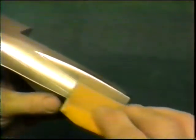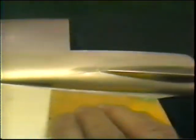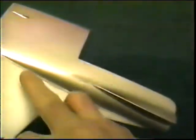It's always these little corners and edges that can be a problem later on, especially if you live in an area where your plane is out in the sun for any length of time. This edge is pretty good, but I want to get the little ramp going into it. I'm just using that little body shop spreader with some sticky-back paper, then I'm going to go over the whole thing again with 600 just to scuff it up. I always say every coat of silver is the last coat, but then I look at it and say, clean it up. But now from this, here's a little spot right here I want to fix — I can feel it.